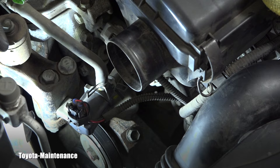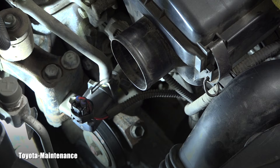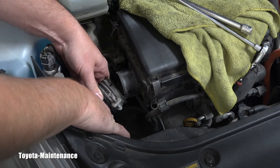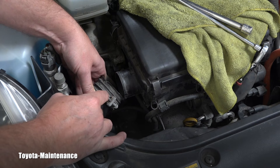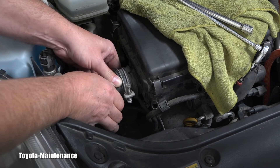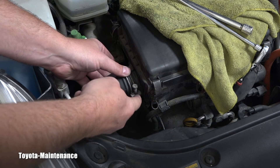To finish the whole job I can carefully reinstall this intake pipe. Now please don't be too hard pulling or tightening this clamp, because you can crush this intake. I saw it this year on a different Toyota and it was completely crushed because somebody went too hard on this clamp.